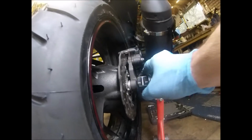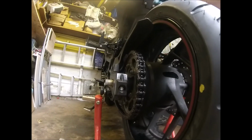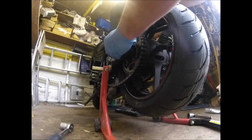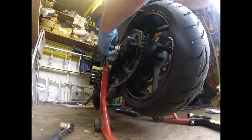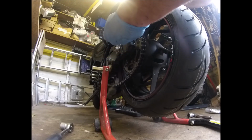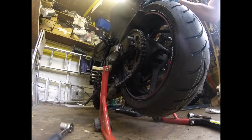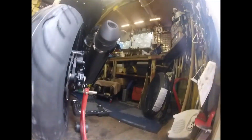As I say, you get your spacer in, your brakes in, got to put the sensor back on, and then this side obviously chain on. Make sure your spacer's in between, and finally on this side you'll have your adapter plate, which is also your marker for your chain adjustment, and then your outer nylock nut. Is it nylock? It looks like a nylock. Yeah, nylock type nut, which is a 32mm this side, and the axle nut is 27. And there you go, that's the kiddie on.